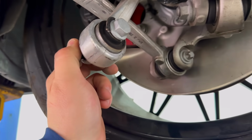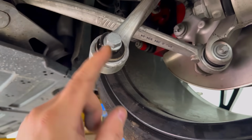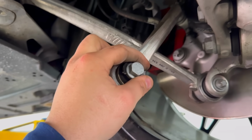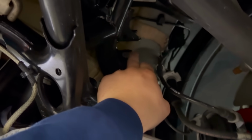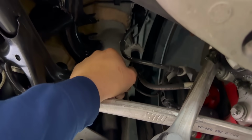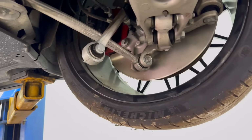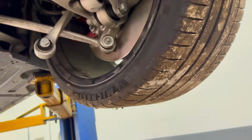No, that looks like it. Oh my goodness. It broke clean off the subframe mounts. Oh boy, that is not good. You can see it just ripped the mounts clean off. Those things are so tiny. We could probably weld that back on, make a little reinforcement plate for it. But I don't know just yet. We're going to have to dig into it later.